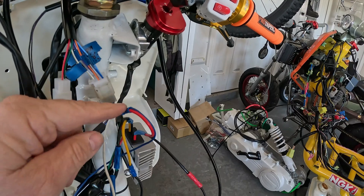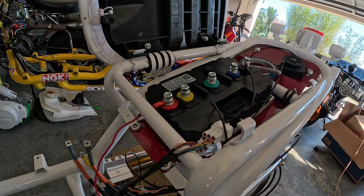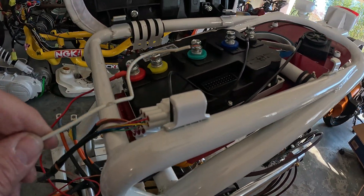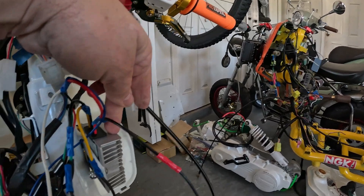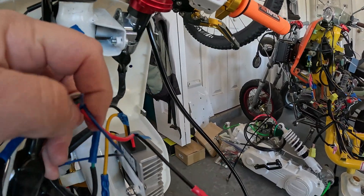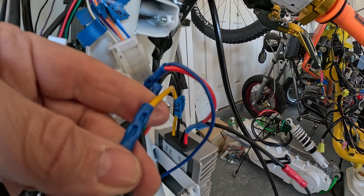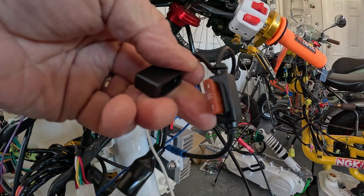The second thing: this little blue wire is going to power your display. The display requires the same power as your system — not 12 volts — because it's going to monitor your battery voltage. The third thing you want to power when you turn this key on is the controller itself, to turn the e-bike on. There'll be a wire coming out of the controller — a white wire that goes all the way back to the rear and plugs into the controller to turn the bike on. So the three things are: when you turn the key on, you turn on your DC converter, your display, and your e-bike itself.